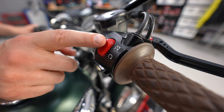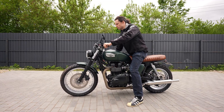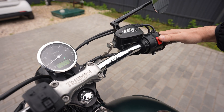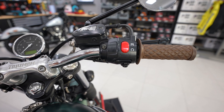The ignition switch is not used in this configuration, but I connected it to the kill input so it stops the engine. This requires soldering contacts inside the switch to close the circuit in the OFF position, making it possible to retain all the functionality of the standard switch controls.